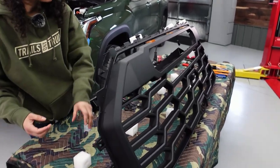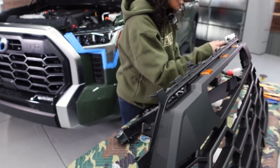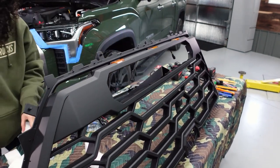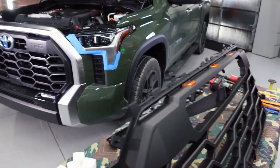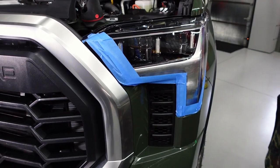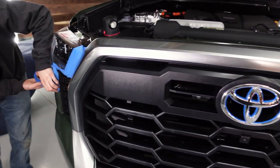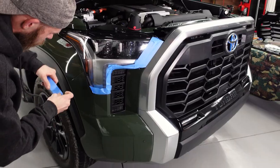So we've got the grill here, and Fanny's going ahead and removing some of the little foam pads that cover the clips. What we're going to do first is assemble the light bar and the Toyota emblem into those two spots, so this grill is kind of ready for the transfer. Then we'll begin removing the stock grill. Josh has already started taping up the headlight — that's just to prevent scratching from the edge, so when you pop this off you don't bang things around and scratch up your nice headlights. I recommend taping yours.